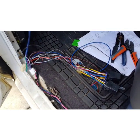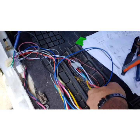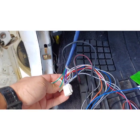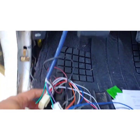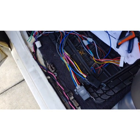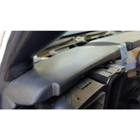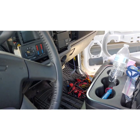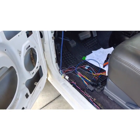So we're back out at the truck. What I've done is pre-wired two relays for the door locks, kind of like the factory setup, and then wired the alarm into that as well. We're going to be sending a positive trigger from the alarm into the relays. Here are all the wires that are going to be plugging into the door. Now I'm going to get the door harness and put the correct plugs on it. To cross over to the other side I got a nine-conductor speaker wire. I took the top of the dash out to send it to the body shop so it doesn't get full of dust — I ran it up there and it drops to the other side, where we'll put the plug for that door so we can run the locks and windows from the driver's door.